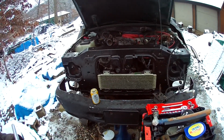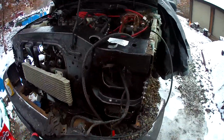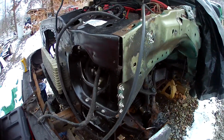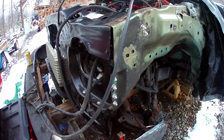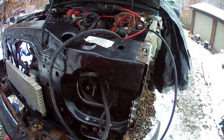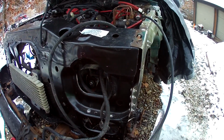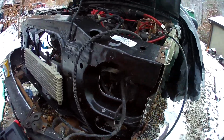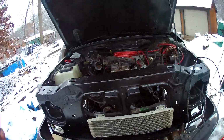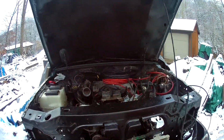Also, out of bolts, I started bolting this all together. As you can see here, got holes coming in from the side, got them everywhere that the spot welds were. These are stainless 1/4 button heads with the flange nuts. I'll need to get a few more because I'm running a little short. So it fits. The hood is on, the prop rod's there. That's all a good start.